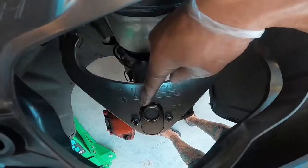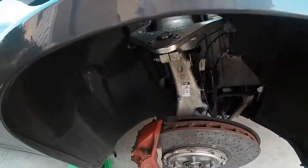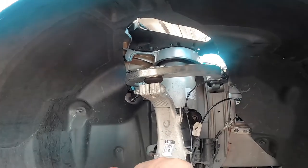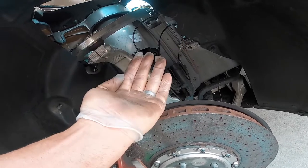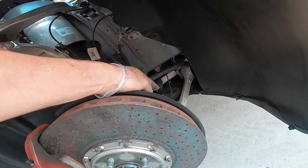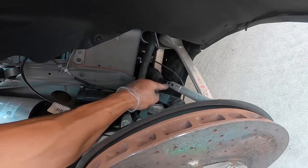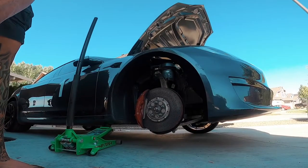This is the little pill I need to flip. You can see it says 'Street / Track.' Take these two off with the T50 and 15mm, support this with the jack because it's gonna drop. Here's how this works: when you camber in more negative, it pushes the toe out, so you pull the toe in by turning the toe rod 360 degrees, which shortens it. When you go back to street setting, you have to bring the toe out again. I mark it with a paint marker and just watch that mark turn 360 degrees.